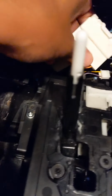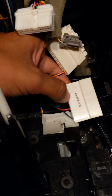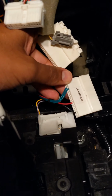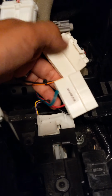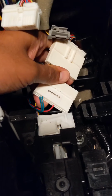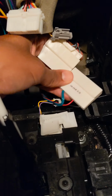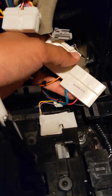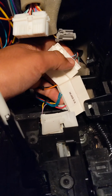The only thing, oh yeah, the mistake that I made, let me go over that. There are these two harnesses that come with your T-Rex unit. One is labeled 08 to 09, which I did not pay attention to in the beginning. It has four wires going to it, and the other one doesn't have a label on it, but it has two wires going in. So what I did was, not paying attention, I had the 08 to 09 harness plugged into the factory harness,